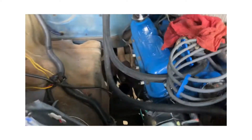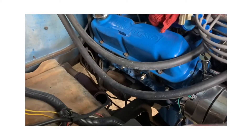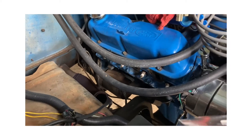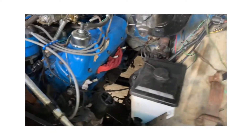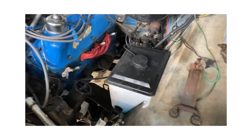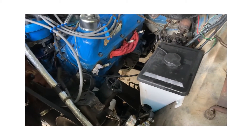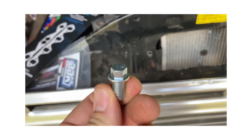To take these old rusty bad boys off, you definitely want to penetrate your header bolts with some PB Blaster, which I used on all 16 bolts. I let it sit overnight and it was fine. Go ahead and remove them with a 9/16 socket — they came off with ease. The new ones are actually 3/8 inch, which is what you'll install.